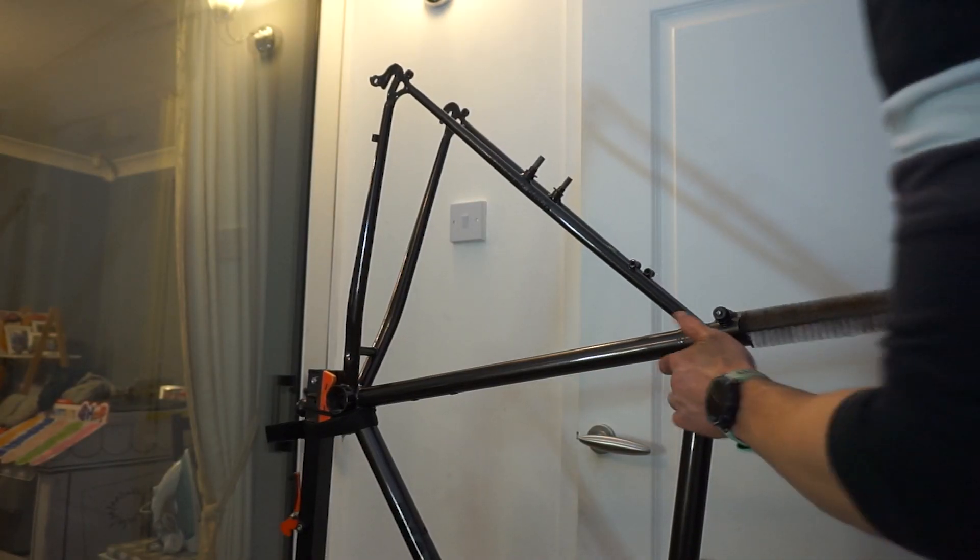After the cleaning I used two files. I used one that had a curved profile — flat on one side, curved on the other — and initially worked away with that. I could still feel inside the seat tube, as far as I could reach with my fingers, that there were still a few uneven sections. So I then took the thinner, more fine round file and worked on those last few uneven sections.